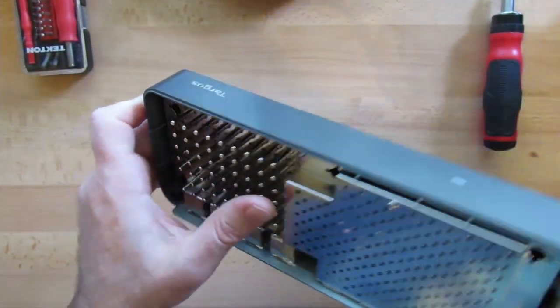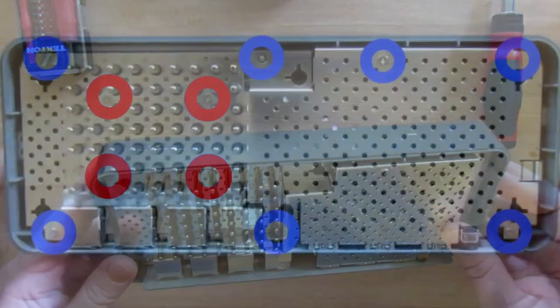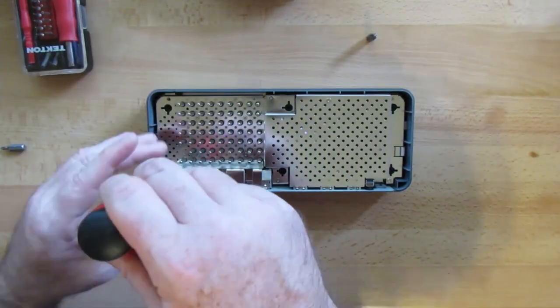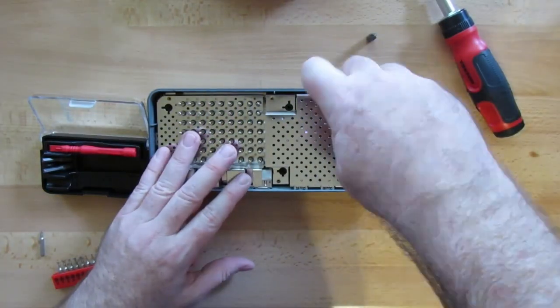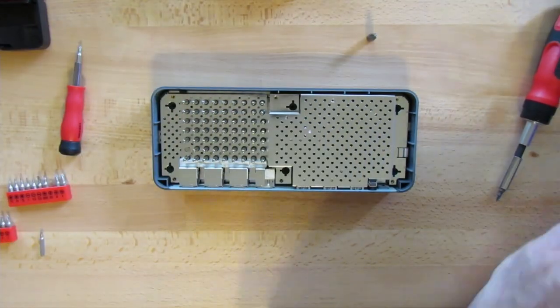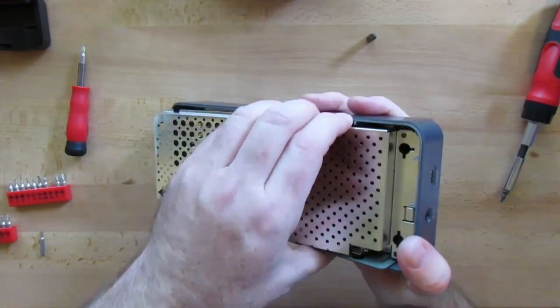Let's take a closer look inside and see how we can extract the innards from the bottom of the case. I can see 11 screws on top. I've highlighted 6 in blue and 5 in red. The blue ones hold the innards into the case and the RF shield, while the red ones only hold the RF shield to the heatsink. Now that I've taken all the screws out, we can go ahead and remove the RF shielding.